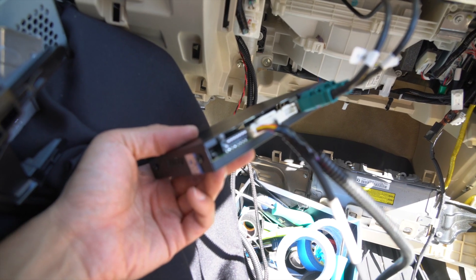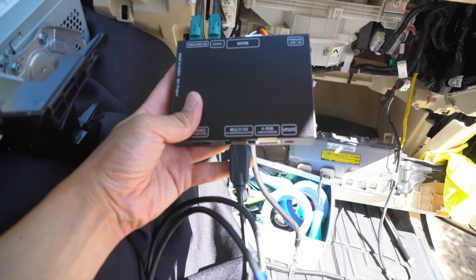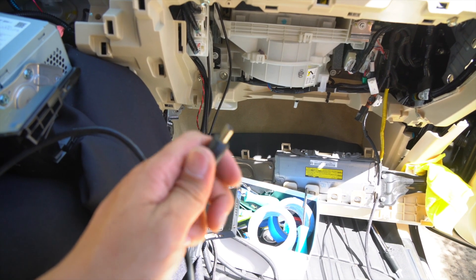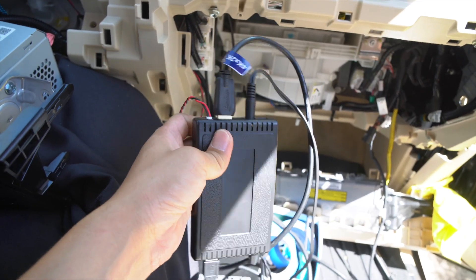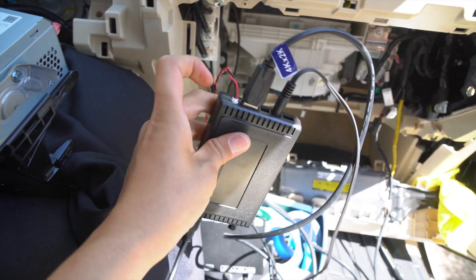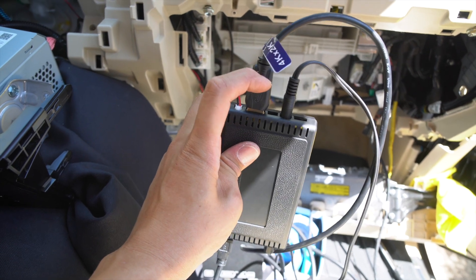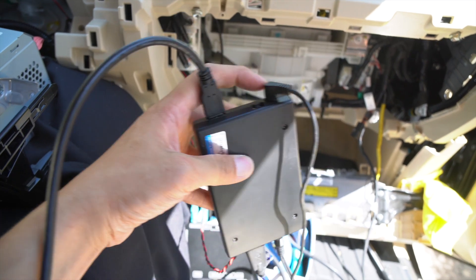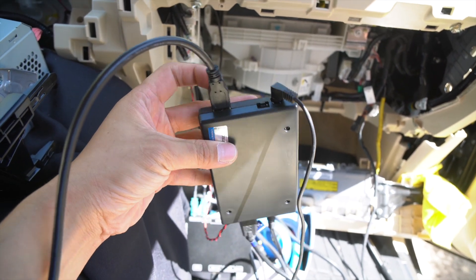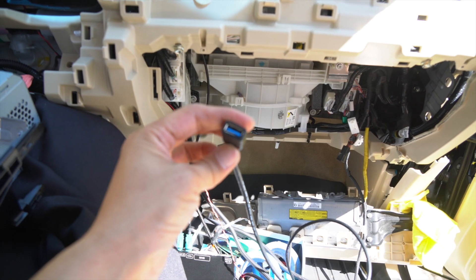On the other side all we have to do is connect this HDMI connector — the HDMI cable is connected right here, and the other side we're going to connect to our CarPlay box. I went ahead and connected all the connections on the CarPlay device. We have the power cable here — this came from the top monitor with the HDMI. We have the aux, and as you can see there are two wires — that's your aux cable. On the other side we have the mic, which is a single cable, and also this USB extension cable. We're going to route this into the glove box, where it will connect to your phone.